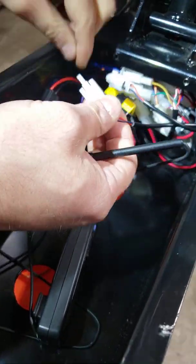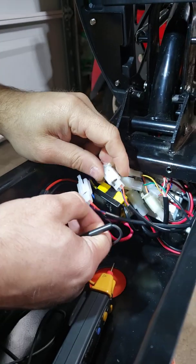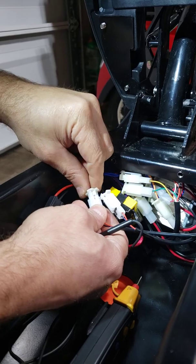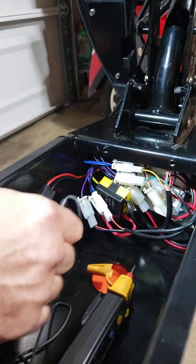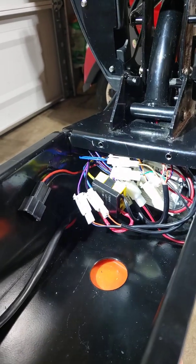So both of the brake handles are fine. But in your case, if one of them is making noise you just have to mark which one that is. And if the other one is not making noise — it's not passing power — then you have to replace that side of the handle. That handle is sold all together as an assembly; you cannot buy just a switch, as I said before.